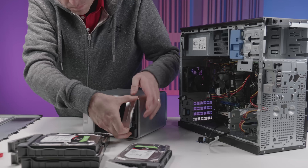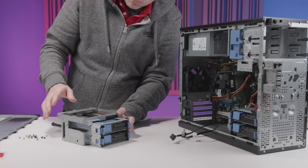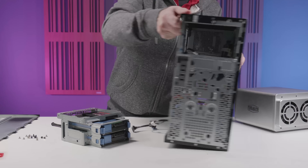I'm going with spinning disks because they're cheaper, and also because options for SSD in this chassis are limited. The T20 doesn't have any support for NVMe drives, and we've used the fastest PCI slot for the network card. I've got four 8 terabyte Seagate Iron Wolf drives in my USB-C enclosure, and I'm removing those and installing them into this NAS. I've got some other older drives that will go back in that enclosure, which I'll continue to use for backups.